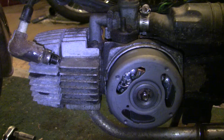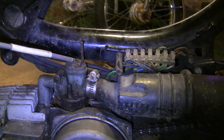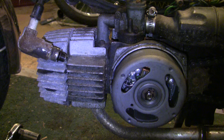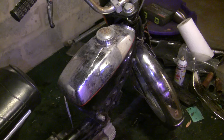We could talk about spark all day — there are so many more things it could be. You could have a bad condenser inside your flywheel, or some bad wiring somewhere. The solution for that is to wire up just for spark; there are wiring guides on the Puch wiring page on the Moped Army Wiki. Okay so we have spark and we have compression — what's next? Next I'm going to talk a little bit about the fuel system, covering the gas tank as well as the carburetor.